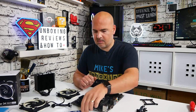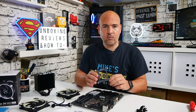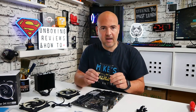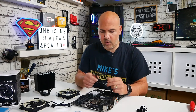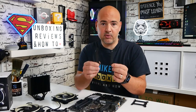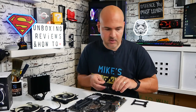Some of the parts we're going to need: we've got our MX4 thermal compound, which is pretty important. Also from the fittings kit inside the box we've got the Arctic included retention mechanism — this goes on the back of the motherboard, and if you look closely you'll see there's an additional hole at the bottom and the Arctic logo printed on it. That tells you which orientation it needs to be when you attach it to the rear of the board. Next up we'll be needing our two brackets — these are multi-purpose brackets used for both AMD and Intel. Depending which way you put them around, that's Intel, that's AMD.